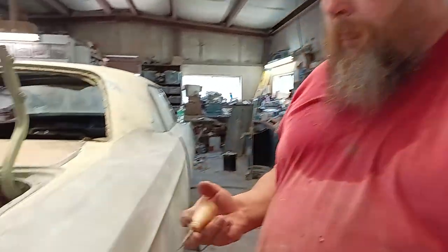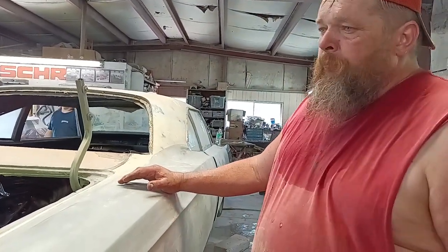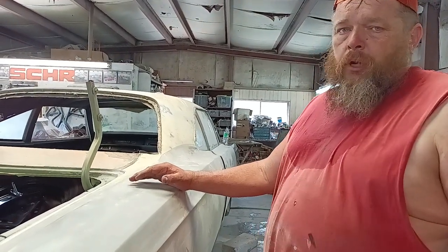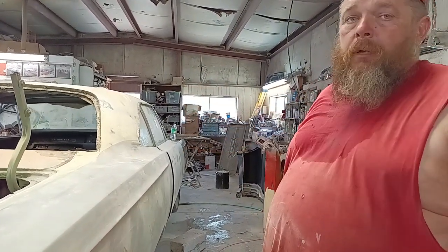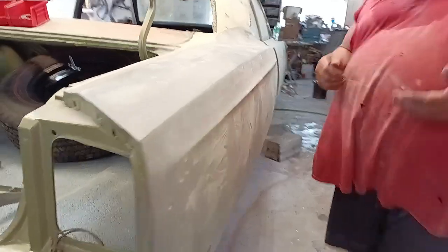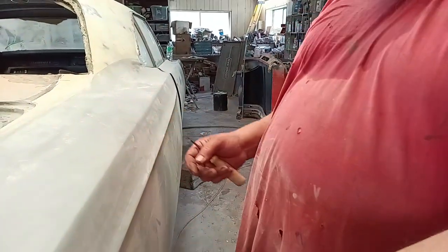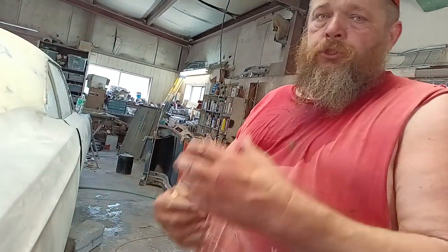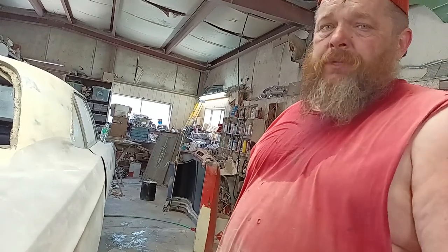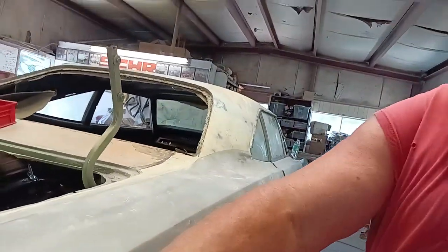What we did was buy the whole quarter panel and cut it off right there on that body seam. If you go back and watch the first Fast and Furious movie where Dom takes Brian into the garage to show him the Charger, you'll see a series of spot welds right down the quarter panel. When you buy that crimping tool with the spot-weld plug and you overlap that metal — that's the way they tell you to do it. But because there are two layers of metal, it will heat and shrink differently, and sometimes at certain temperatures you will see your welds. What we did here was cut on that line, take our time with the MIG welder, and weld it solid. There is no overlap — it's a solid butt weld all the way down. You get up inside and you can't see it.